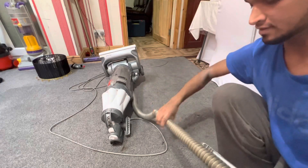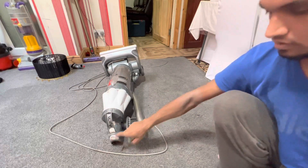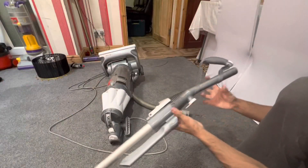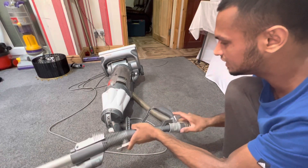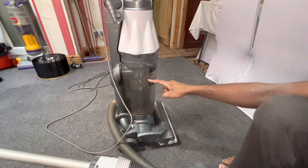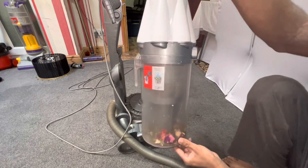The hose isn't going to be blocked because the wand goes inside the hose, so it's definitely with the wand. If I just pull the hose off we should now have suction — yeah. Looking inside the wand, let's see if there's a blockage — yep, there is. Luckily with the DC07 you can reverse the suction on the wand so it should self-clean. If I put the hose cuff on the other end it should clear the blockage, and anything that gets sucked up you'll see coming into the bin. A load of confetti to celebrate that it's unplugged!